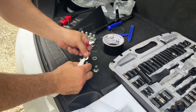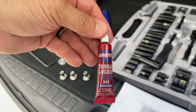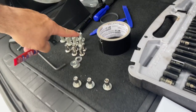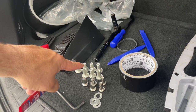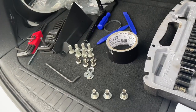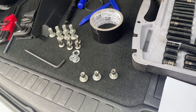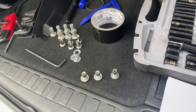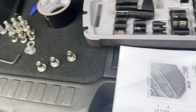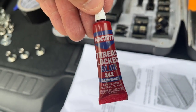The first thing you're going to want to do is put three washers on — these small ones, you're going to have three that go on first. The next thing you want to do is get some blue Loctite — it's removable, but it's going to hold these down. Listen very carefully: there's a guy who put a roof rack on, he's on vacation with a $900 top-of-the-line cargo box. As he's going from Texas to Florida, it gave loose — one rail started lifting up and he lost the whole roof rack and topper. Why? Because he was cheap and wouldn't buy thread locker.